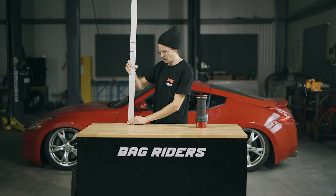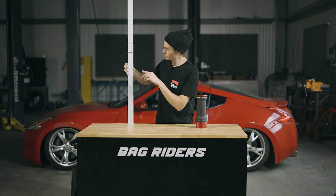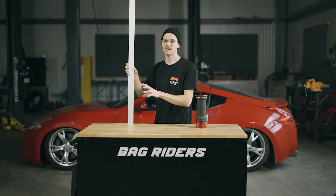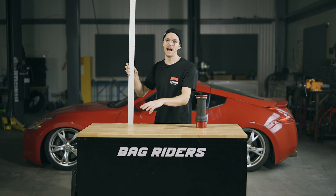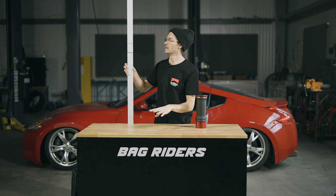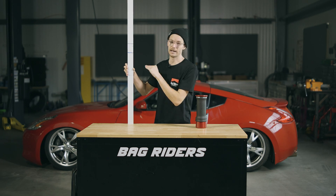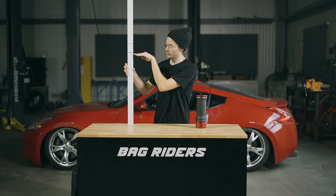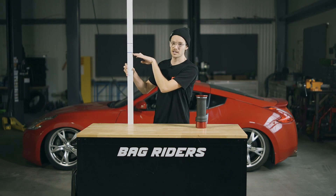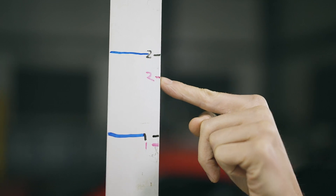We saw how that all shook out and we have a couple of key pieces of information to go over. As a reminder, we drew our black lines ahead of time, set the presets visually knowing the actual height we wanted, marked those in black, and saved them on the controller. The next step was a real-world example of going from a very low height — aired out — up to our preset, having that bag unroll to get there. We noticed it was pretty close for the low height but quite inaccurate at height number two, which is a pretty big issue.